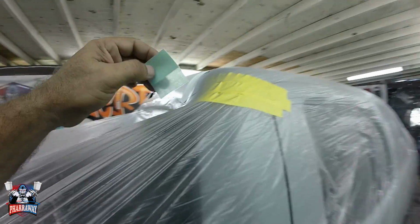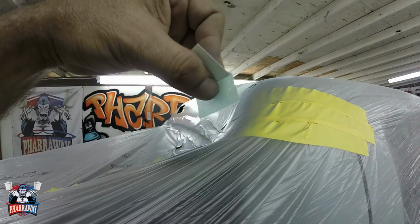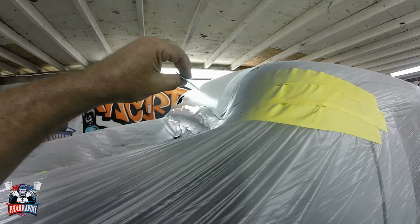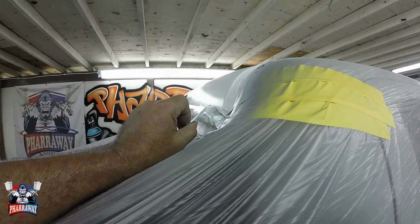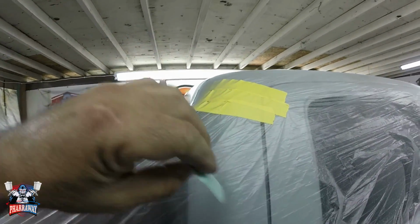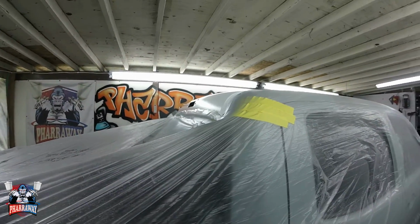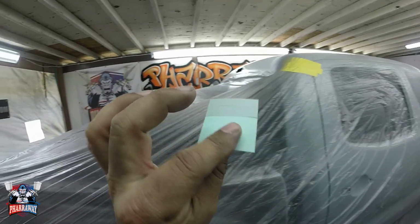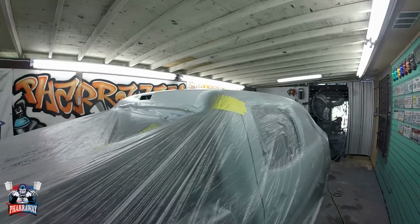So what you do, you put this plastic on the back of the molding, you remove the white paper and just pull it, and it'll lift the molding, and just tape it up and just keep on going. I tore a piece. They come in sections. You can use as much as you want and it'll lift up that molding. That's how this thing works. Real nice. I'll leave the information in the description. So let me just spray the other 2 coats, then I'll come back and show you the pearl.